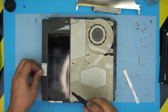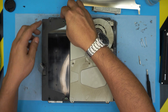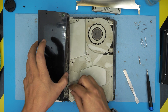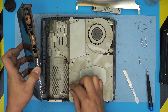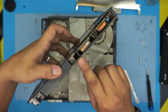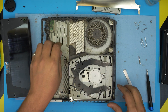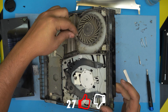Some models don't have this Wi-Fi cable, so don't worry about it. Simply slide the power unit out — lift it up slowly and untangle the Wi-Fi cable. Pull this cable out from the power unit; it's a tiny jack that only goes in one way. Look at all the dirt in here — we've got to clean all this up. Remove the protective case on top and you'll have exposed the DVD drive. Look at all this dust — just peel it off.